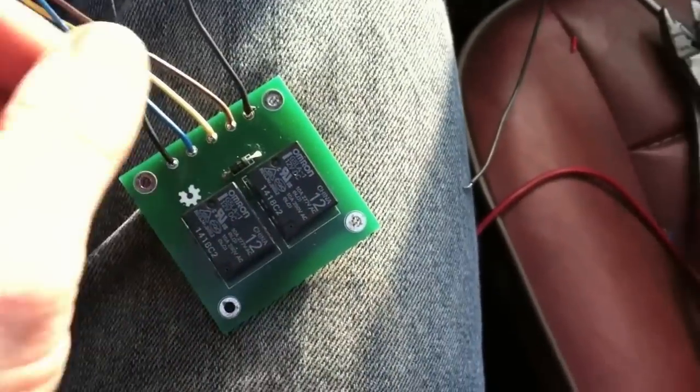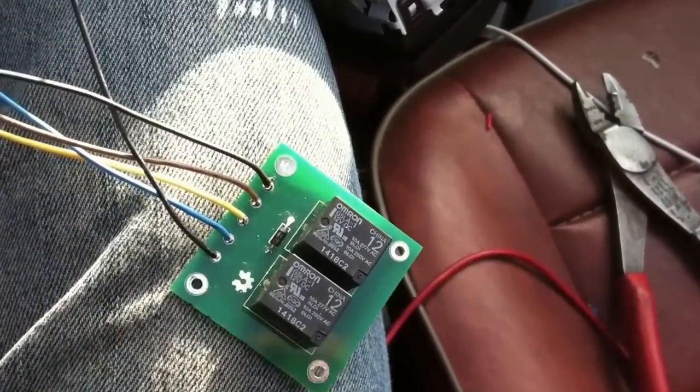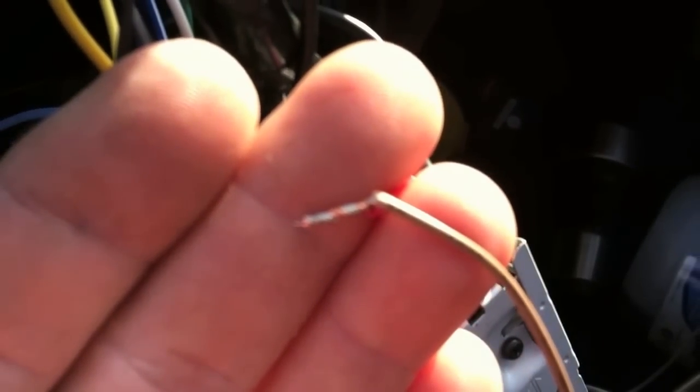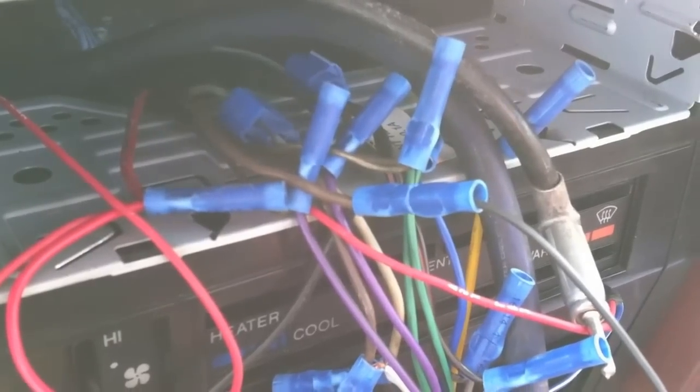Here's a bit of a work in progress — I've got everything except the door trigger wired in. I will probably label these wires when I ship them so they've got little flags on them. The yellow comes up and I stripped the middle of this yellow going to the radio and just wrapped it around it. Here is the red — the blue goes to the car side of the red wire, and the brown comes up and goes to the radio side of the red wire. I just cut it, spliced them together, wrapped it. If you're feeling ambitious you can solder these, but being car stereo stuff I usually just wrap it with some electrical tape. I just went and crimped it on the other side of a butt connector for the ground, but generally any good ground source will work.